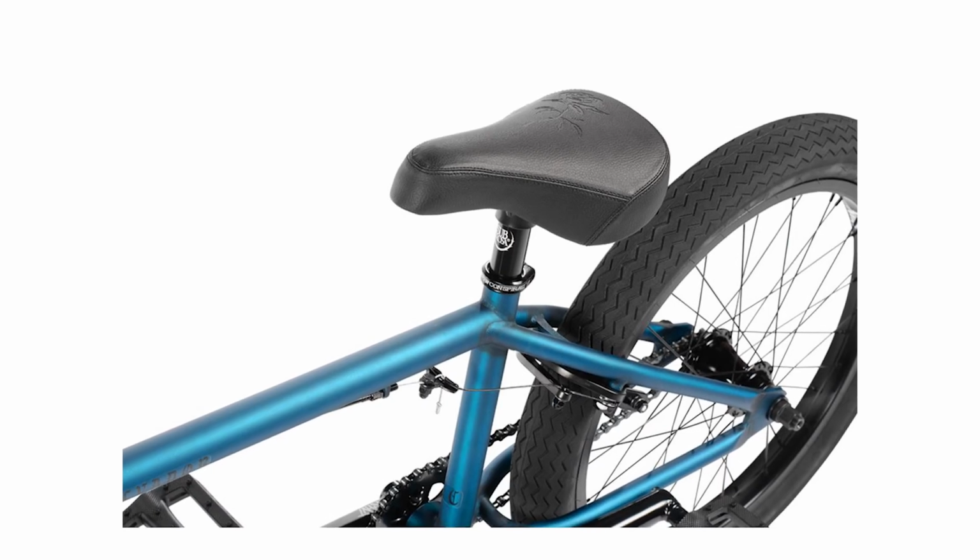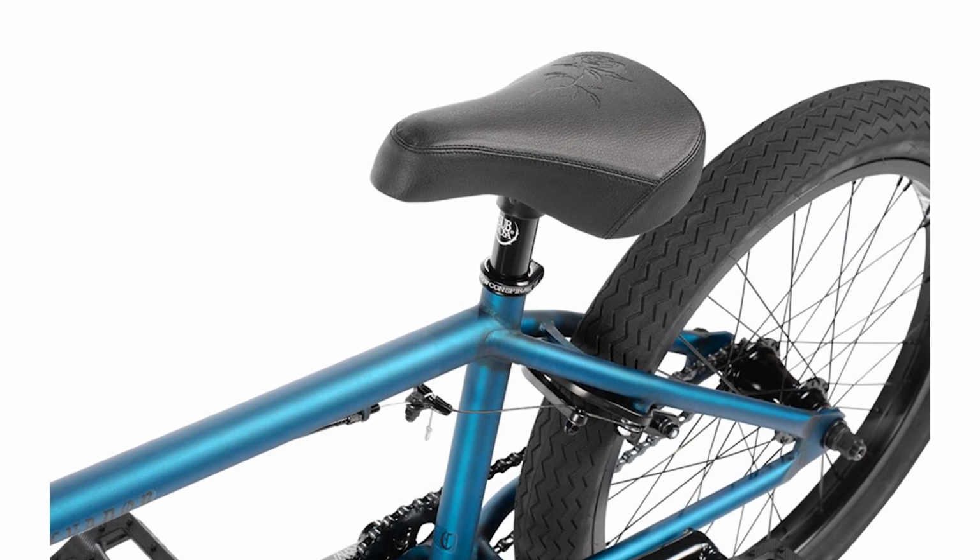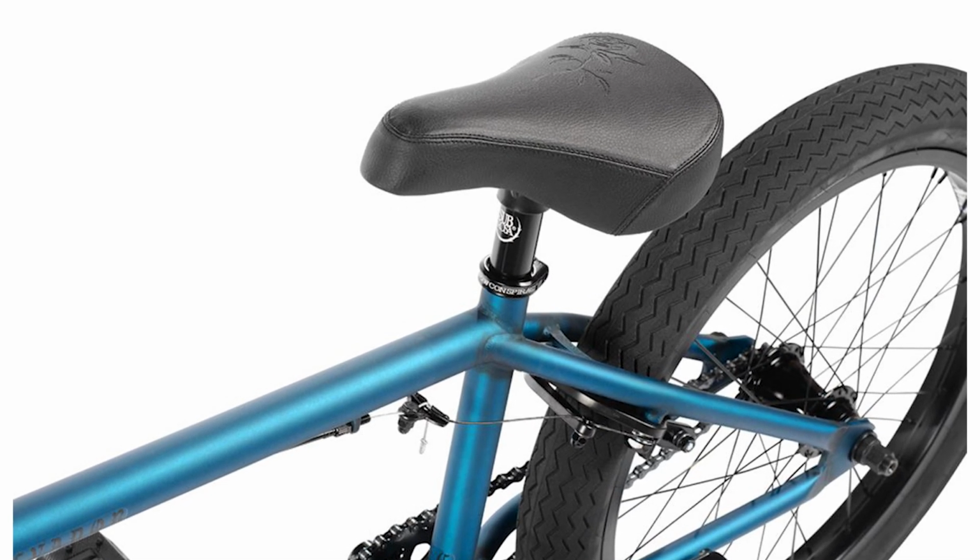and it makes it a little bit easier to pedal, because you have more leverage, but it's harder to get a full revolution around. You're not going to pedal as fast as you would on 160 millimeter cranks. This is something that you just got to try different things to see what feels right, but generally for a taller rider, longer crank arms is the way to go.